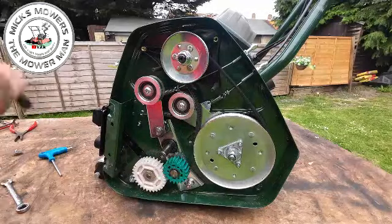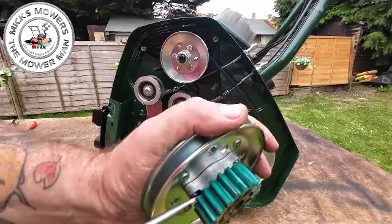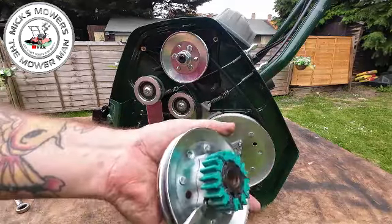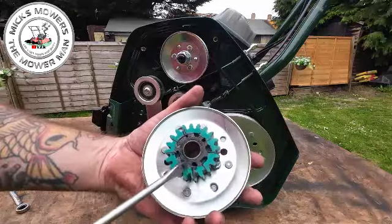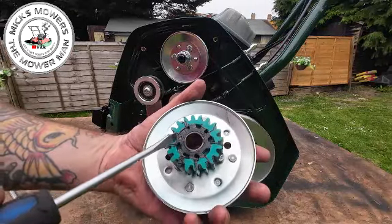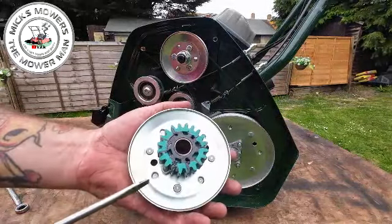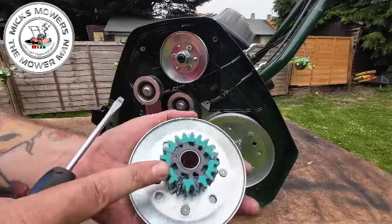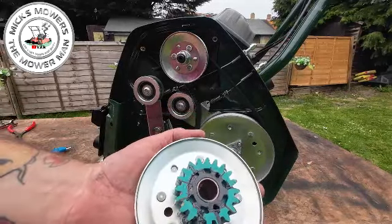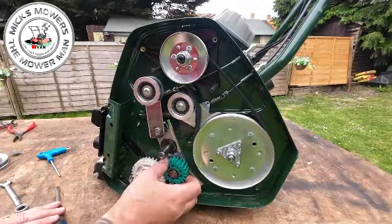With that bolt removed we can now loosely remove the cylinder pulley, and on the back side will be one of the gears. To remove this gear, simply get a flat-headed screwdriver and just creep it up ever so slightly and that gear will actually come off - especially if it's broken you'll see it clearly. Inside there will be three pins. Once you order your new one, just drift the new pins back in and gently tap with a rubber mallet - easy.